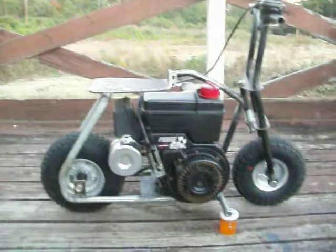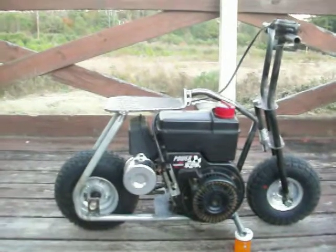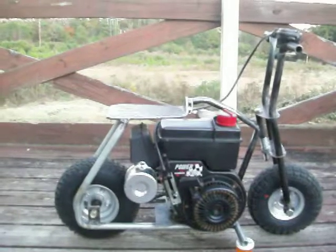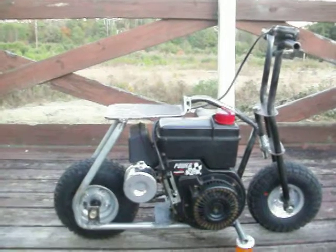Okay guys, done some work to it today, made some headway. Notice any difference in the hump now? Built a plate and let it double as the top rear half of the frame. That's 1/4 inch steel, so there's no flexing in it at all, not in a piece that short.